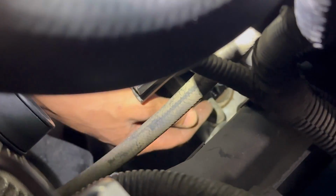The radiator end tank is leaking. I don't know if you're going to be able to see it on camera. It is right there. Guys, you just have to take my word for it. I smell the coolant. I don't think you can see it right down here, the little puddle that is accumulating. Is it that wetness shining? I see it. That's not the hole though. It's got a crack in the end tank. It's hard to see.